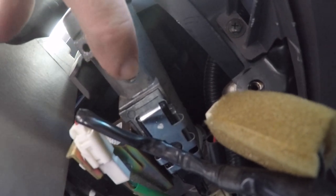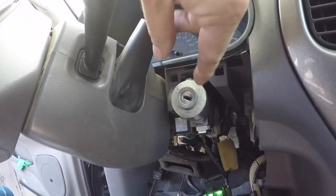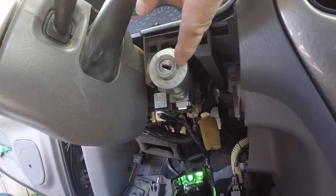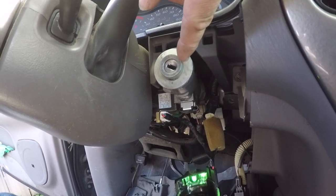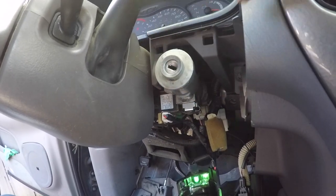Thanks, Toyota — that's fantastic. Now of course there is a workaround: you have to get underneath and from this little hole right here we have to drill out the retaining pin that is holding the cylinder in place. Drilling that out should allow us to remove the cylinder, and then a locksmith will be able to repair it. I watched some videos on how to repair it myself but there are too many things that could go wrong, so we're just going to focus on removing it and getting it to a locksmith.